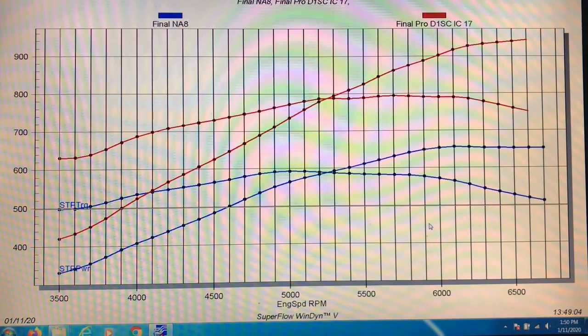As you can see, the rising boost curve from the ProCharger pushed the horsepower peak up by 500 RPM from 6,100 to 6,600, and pushed the peak torque up by 700 RPM from 5,000 NA to 5,700 with the supercharger. Now that we've seen what the power output is with the ProCharger and the small standard air-to-air core, let's find out what happens when we upgrade to their larger 3.5-inch diameter in and out core.